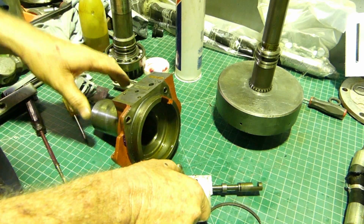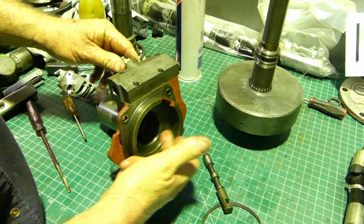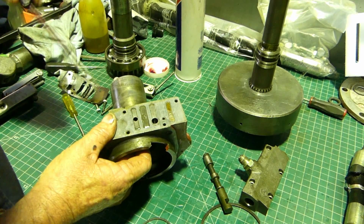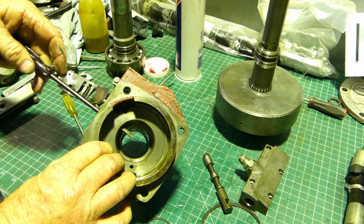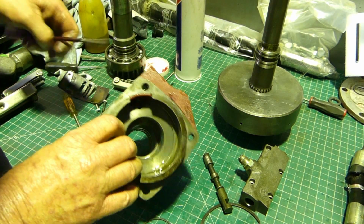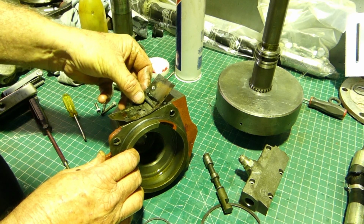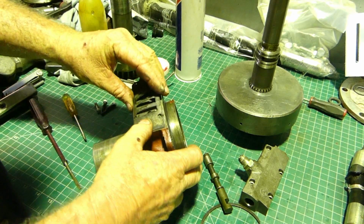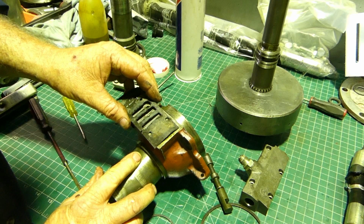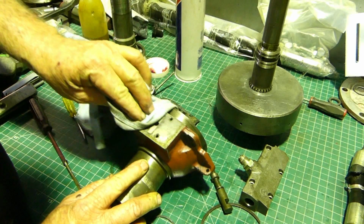Now, when we look at this sitting here, we know if we pull it out, it puts oil into the clutch pack, and if we push it in, it doesn't. So all it does there is, you can see this gallery here, that's the gallery that pokes out and seals inside the rings here, which then in turn seals in these rings here and gives you oil supply. So if you were to pull this apart and you found this gasket with a tear in it, or anything like that, you could come to a reasonable conclusion that it wasn't working because of the low oil pressure. It didn't have enough to lock up properly.